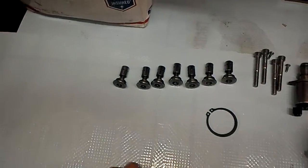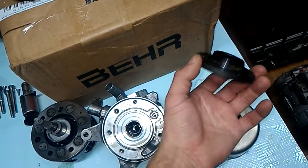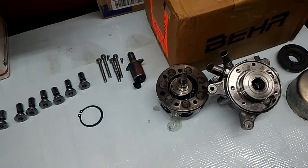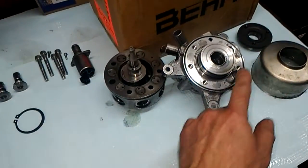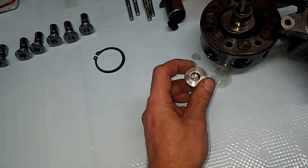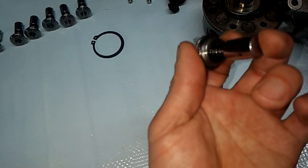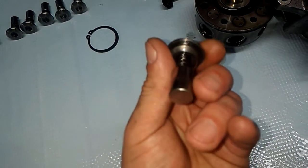The first thing is this pulley — it was something else. To pull this off, you have to heat it up with the puller, then you remove it. It was very tight, so if somebody opens it up, just know this is not easy to pull off. The little piston covers were also really tight. I had to use quite a big wrench. There's sealant on the edges, as you can see here.